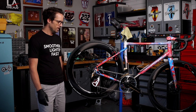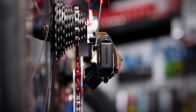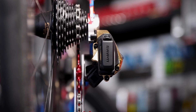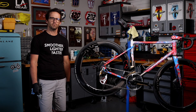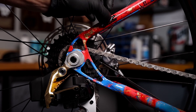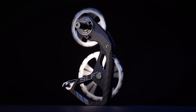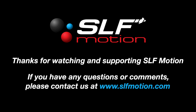Once your chain is installed correctly, there are four more things to do before we can get back on the road. First, you will need to adjust the B screw. Next, you will need to adjust your high and low limit screws. And lastly, you will need to readjust the trim. I want to say thanks to the Chesser family for letting me borrow one of their beautiful road bikes. And now for my favorite part of every installation. I'll catch you in the next video.